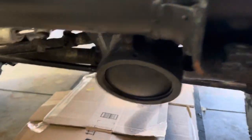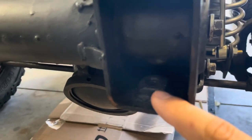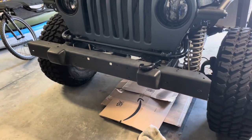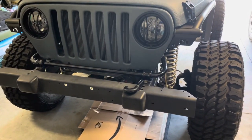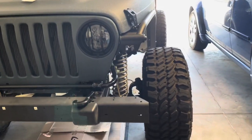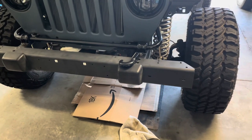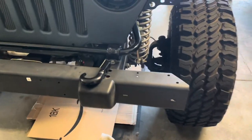I went with 2 inch on top and 1¼ on the bottom. The shorter one's on bottom because when you come up in through here, you're going to hit this piece of the frame and you don't need a bolt going too far up. On first glance, you can see why I want to go with more of a stubby bumper that doesn't come out as far with these new fenders and that offset.